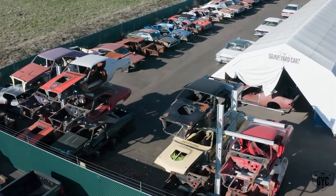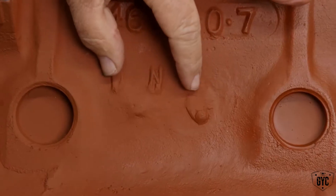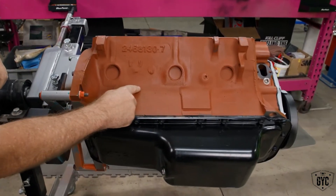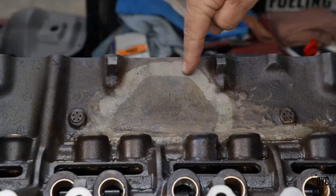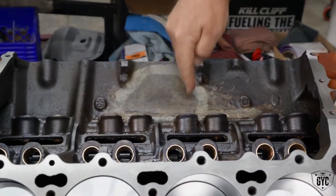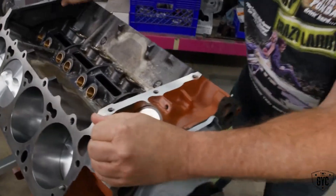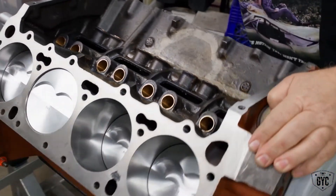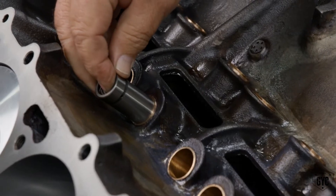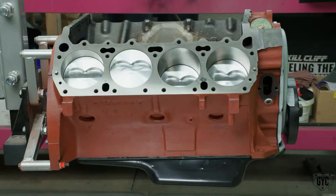Overall, I've never seen an engine get that much work done to it at one time. The good news is we do have the engine back from the machine shop. Back from being welded up — like I said, it was a complete mess. If you looked at it during the process you thought, 'There's no way.' Right now it looks good. Even cosmetically the repairs look good on the outside of the block where the freeze cracks were around the expansion plugs — they dressed that up real nice, gave it a texture, and you can't tell once it's painted. The intake valley repairs are visible until the intake manifold goes on, but absolutely fantastic job. You can see the bronze bushings stick up a little further than the factory ones, but there's no interference problem, and the lifter itself is a really nice tight fit — probably tighter than it would have been against cast iron.